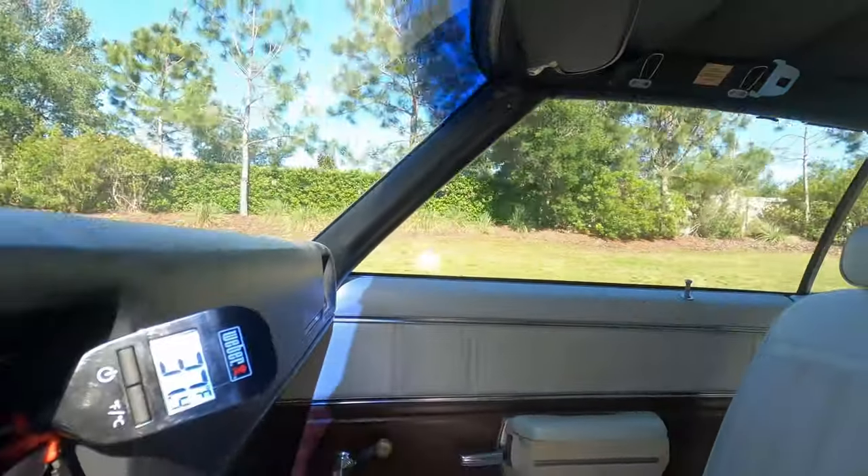After driving around for about 10 minutes at 40 miles per hour and around 1,500 RPMs, we're sitting right at 37 degrees — actually 37.5. This is great. I'm not going to do anything else to the system for now. We'll see how it handles longevity-wise. I probably could push a little more cooling by adding a bit more refrigerant, but I don't know what I'd gain from another 5 degrees when I risk freezing up the evaporator. I'll do some videos on the hotter days in the summer and see how it handles upper 90-degree temperatures.